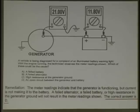By the way, all of your newer cars nowadays, when you put a meter on the battery and everything is good, in the old days you had 14.7 to 15.2 volts that were regulated, right? You notice some of the new cars, you can sometimes get them up to 17 volts? The computer is regulating it based on how that battery is. You want your butt warm, you want the stereo on, the wipers, the rear defroster, the power, everything, that battery is going to get drained down a lot, right? So they need to put more in as quick as they can, and sometimes you'll see that.